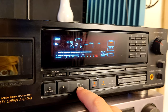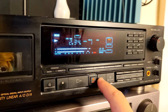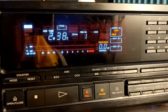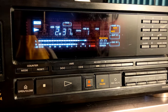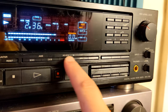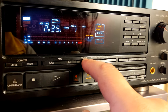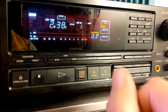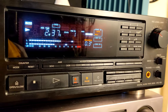Because it's a DJ mix, let's say this is the second track, so I'm going to press Start ID. You can see it's going to go back a little bit and write the ID block — that's our second track. It's on rehearsal mode, so you can adjust. If the position isn't good, you can go one or two seconds before or even ahead — you can do fine adjusting for where you want the second track to start.